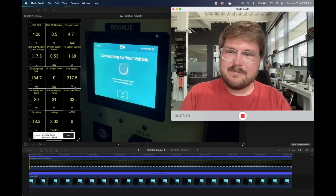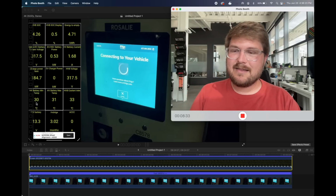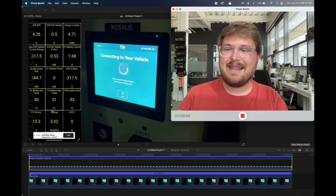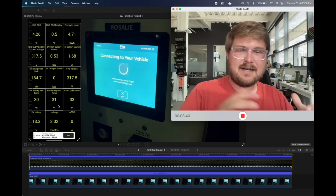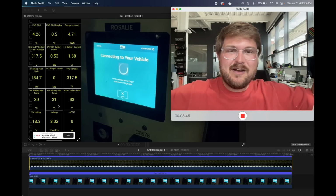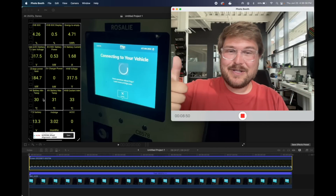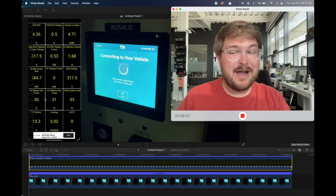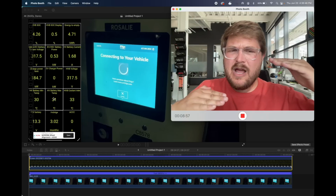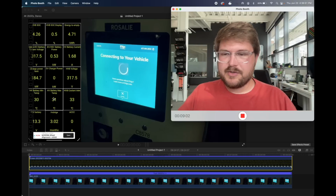I just, for some reason, messed up and I have two battery pack voltages here. I've also gone through and selected the lowest battery pack temperature sensor, and the hottest. So the coldest and the hottest. Again, the battery pack is huge. There's a lot of thermal mass. It's a big distance. There's going to be varying temperature readings throughout. And so basically I said, show me what the coldest spot is and the hottest spot. And surprisingly, the F-150 Lightning seems to do a very good job of keeping those close when charging. When you're driving, there is some sway, and that's totally normal, no big deal.